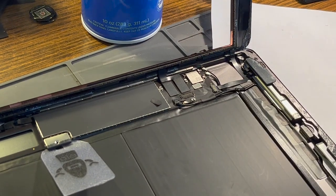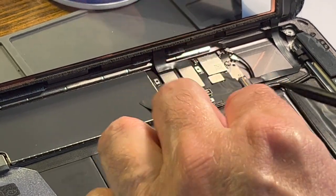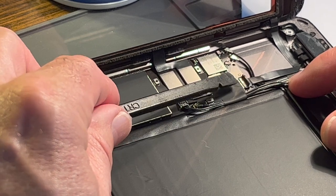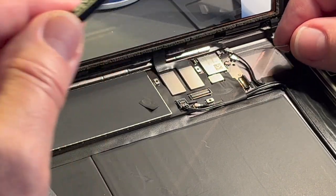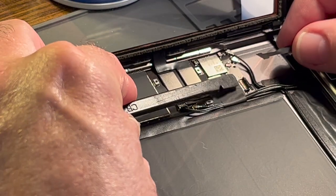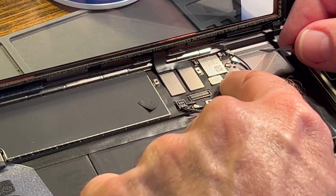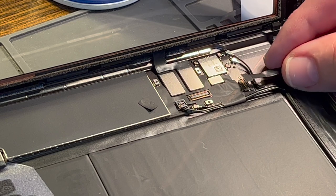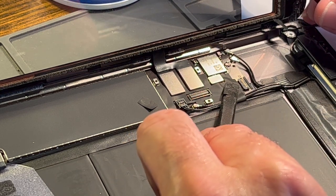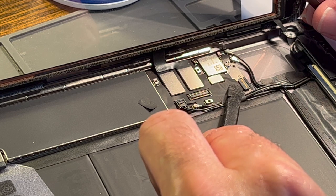This connector has a little door on the edge that you flip up. I just ever so gently lift that little flap — that's going to let me pull this cable right out. You don't want to yank this cable out until you lift this flap, and you don't want to use a metal tool. Use plastic and do it very gently because this little flap is very, very fragile. It can crack or break, and then you'll have a poor connection when you try to put your home button back. I get a lot of iPads in where people tried to fix them themselves and their home button doesn't work — it's because they tore or cracked this flap when they were lifting it.